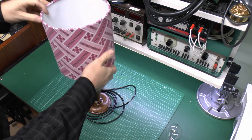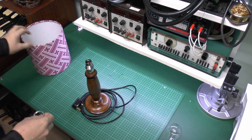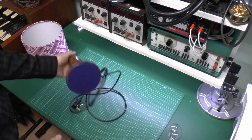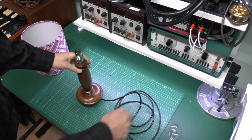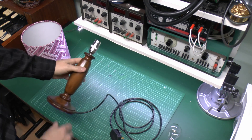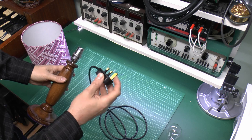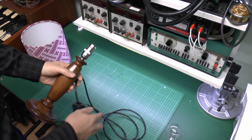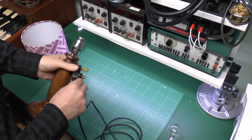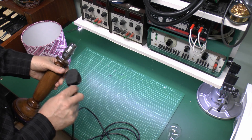Here is one of the lamps, so let's remove the shade from that. This is one of the tall ones - the shorter one is in the other video - but basically they're all pretty much the same. Now in terms of testing these, the first test is to make sure that the earth pin, which is the large pin on this UK plug, is actually connected to the metal body of this lamp holder, coming through the cable and up inside and connecting onto that properly and securely.